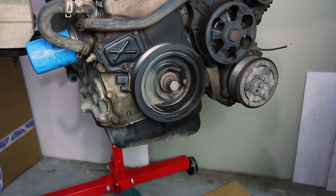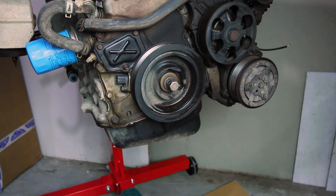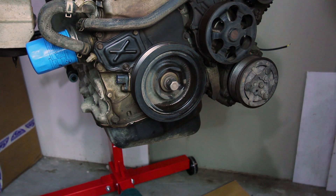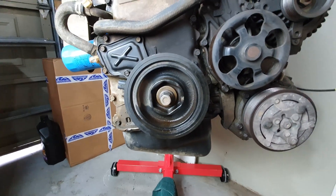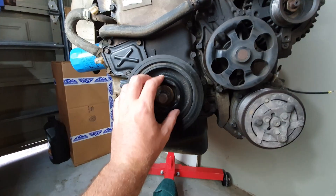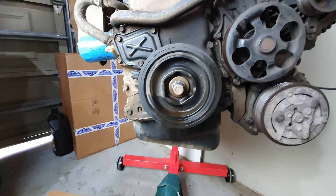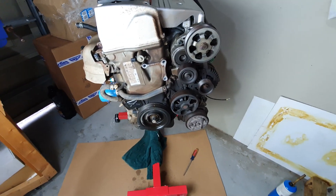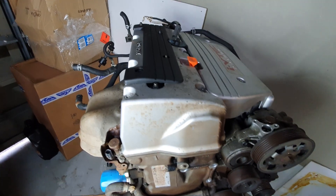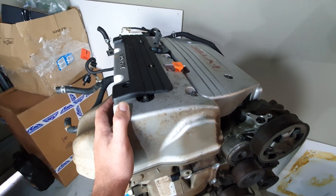I need a proper tool — a weighted socket or a harmonic balancer socket. But I live in New Zealand, so there's probably none around, probably a week's wait from Amazon or some shit. This crank bolt completely beat my ass yesterday, so later on today I've got a friend coming over who's got a harmonic balancer holding tool which should fit in here. We'll have to try with a pry bar or a couple pry bars. In the meantime, I can get some of these lines off and take off the rocker cover and have a look at the condition underneath that.